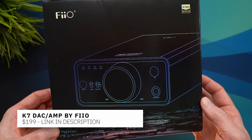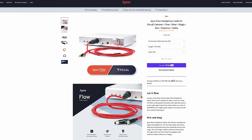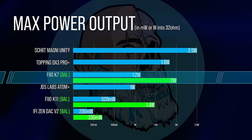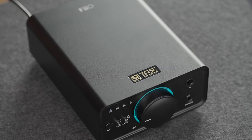We'll look at the FiiO K7 first, priced right at $199. This is a step up from the K5 Pro I reviewed a few years back and is an interesting comparison to the DX3 Pro Plus. The big thing with this one is balanced output — and balanced isn't really a beginner thing. Everything we've looked at so far has single-ended output, or a regular headphone plug. Balanced output generally provides more power, but it requires your headphone or IEM to be designed for it and requires a specialized cable that can be very expensive and isn't normally included. There's no remote and no Bluetooth — you can get a Bluetooth version but it goes for about $249. For power, it places third on the list at 1.2 watts into 32 ohms single-ended, but delivers 2 watts at 32 ohms running balanced.